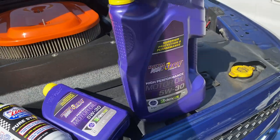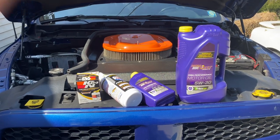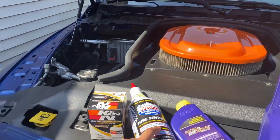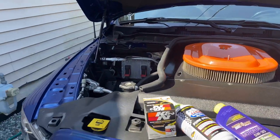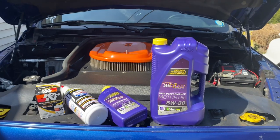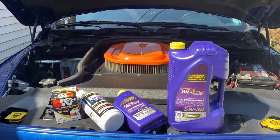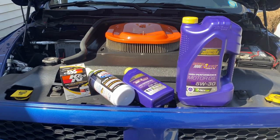As far as oil, I know a lot of people have their preferred oil. The recommended is 5W-20, but I've found that 5W-30 quiets down the valve train a lot more. With this stabilizer, it definitely quiets it down more because these HEMIs do have loud valve train noises, especially after doing long tube headers. I've found this works pretty good for me. A lot of people recommend Redline, and I do want to try it — I'll order some and let you guys know how that performs.